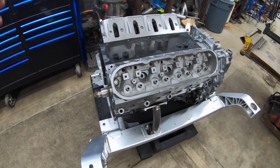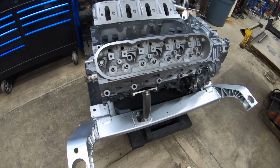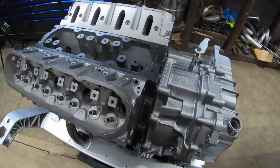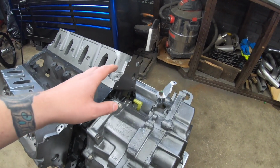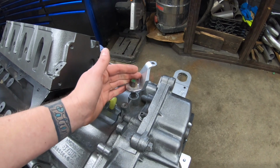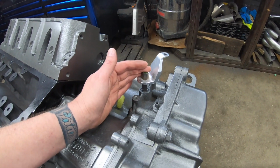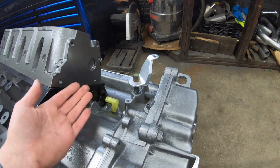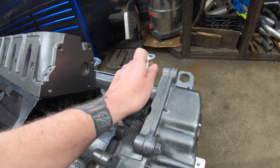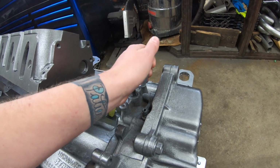Now, once you get it all bolted up on the subframe, you go to put it up in the car, you've checked all your clearances. One other thing you should really take into account is your shifter. I do not recommend running a factory 4T65 shifter. The detents are different spacing than a 4T80 shifter. I've actually measured a Cadillac shifter in comparison to one out of my Monte Carlo. And what I found works the best is a ratchet or gate style shifter.